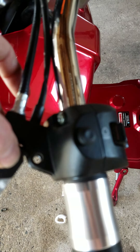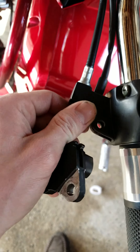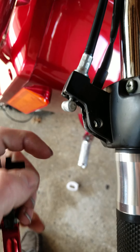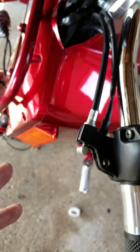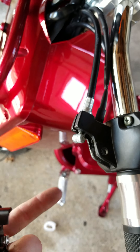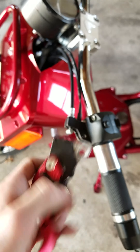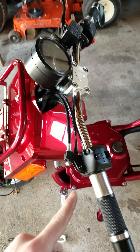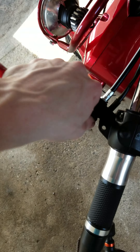I'm gonna go ahead and pop this on — it's real easy, you just slide it over. This will more or less be the same process for a lot of these with the drum brakes, with the cable-guided drum brake. Most of them are going to be cable-guided for the drums. The front brakes are way easier — you don't have to worry about a cable line. This would actually work in the same process as a clutch line too since it runs into the same concept. I'm gonna go ahead and drop this on and we'll see how it looks going from the stock lever to these adjustables.